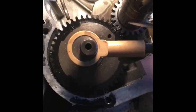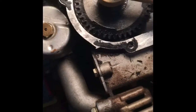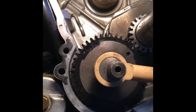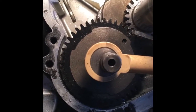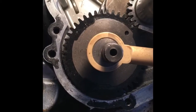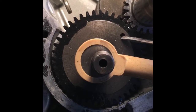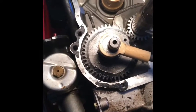How you time these — Briggs are very similar to this. I've actually had to do this on a Briggs recently. I'm using a cell phone here. You see a mark right there? You can probably hardly see it, but there's a mark right there in the gears. That is supposed to line up with this mark here, which lines up with this hole here. That times it so that it's correct.